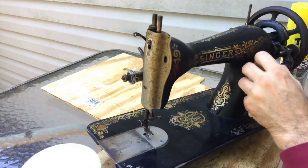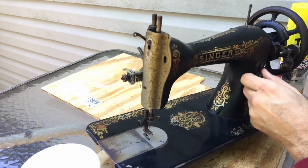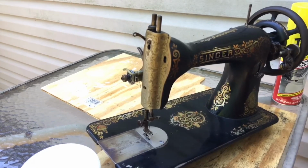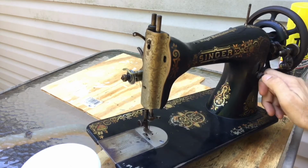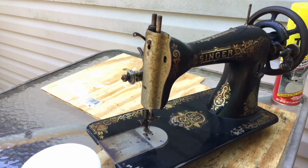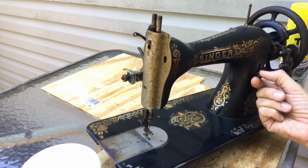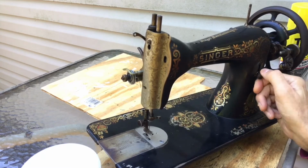But a lot of times when you get an old machine, you may find that the knobs are stuck. They're not broken, they're just frozen up because old oil over many years gets like glue, and parts of a sewing machine will be basically frozen, right? They're like the Tin Man in The Wizard of Oz. They need gentle prodding to move again, and sometimes I use things like liquid wrench and other things that you guys have seen in the hardware store, things that you can use to loosen up hardware, but you never force things, right? If it's not ready to move, then you want to give it time.